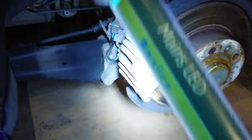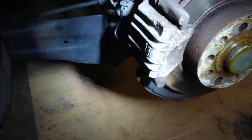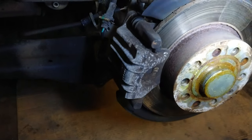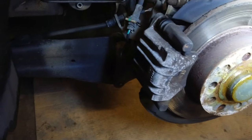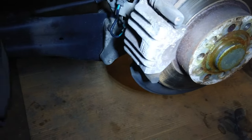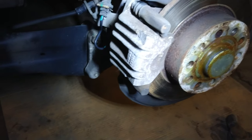I'm going to change the pads on this. I noticed when I painted the front calipers that the back pads are a bit rough. The discs are a bit rough as well actually. There's plenty of thickness left in them so I'll give them a clean up. The calipers I'm going to paint them blue like the front ones.